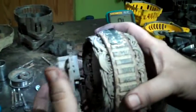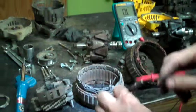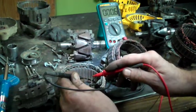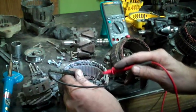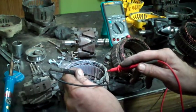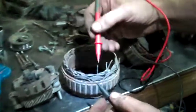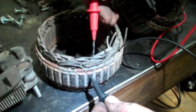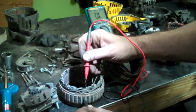On this one I took the stator off from the rectifier unit. This is the rectifier unit, and this is the stator. This one has four wires; the other ones all have three wires — I'm not sure why they're different. But these wires should all be connected together. Between one and another I should get continuity — yeah, it's like 0.3 ohms, which is basically nothing. They're connected. This one 0.4, this one 0.3. These are good. I also want to make sure these are not shorted out to the outside. I'll scrape off a little piece to make sure I have good contact — yeah, there's no connection there.